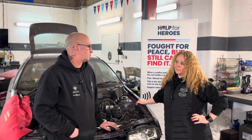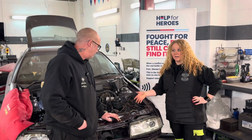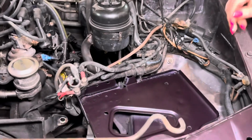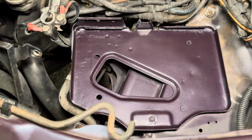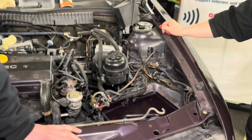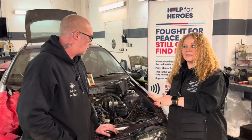Right, so moving over to the battery tray. Corroded and pitted was the issue, and obviously you took that job on. Yep. Sanded the corrosion back, just get rid of a lot of it, and some rust treatment. Skim of filler, flattened it all off, and then just primed it and painted it. Brilliant. So we kept doing little bits in between. I'll put that on for you now.